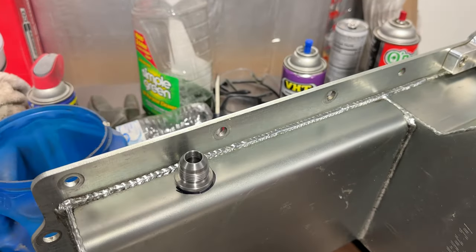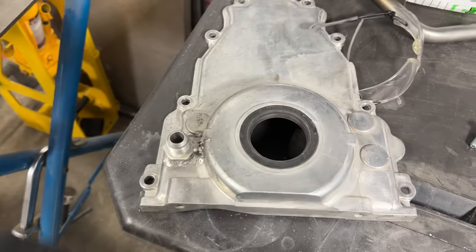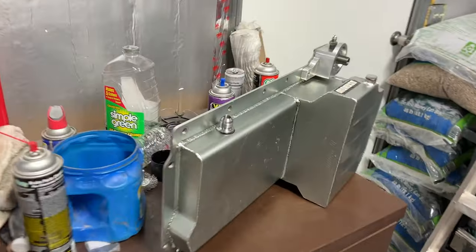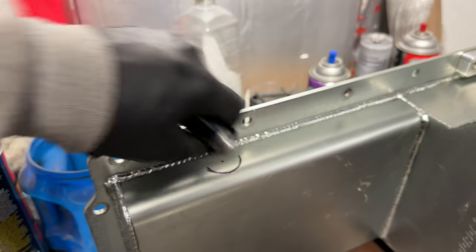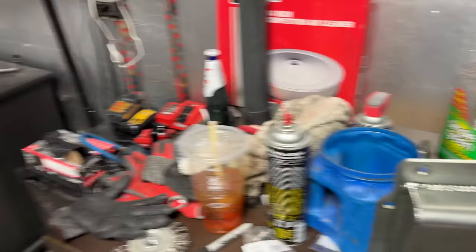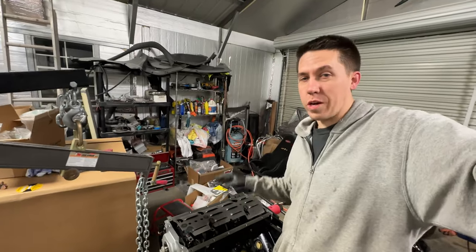I was looking at it and I think I'm going to mock it up right about there on the oil pan. I used to have it on the timing cover — here's actually the old timing cover, as you guys can see it was up here. With the turbos trying to mount low, I'm going to try to run them here. The lower I can put the oil drain bungs, the better the chance of not having to run a scavenge pump. With that 10 AN there, I can angle it and hopefully it'll come up and out and still stay low over the turbo — so it drains in, which is what I'm hoping.